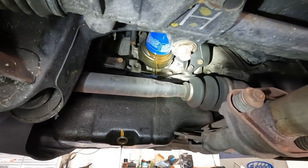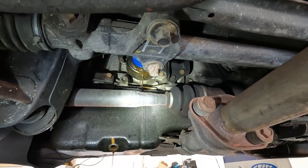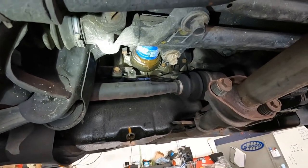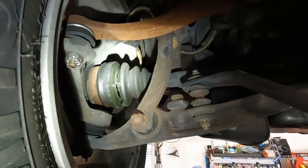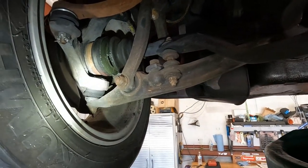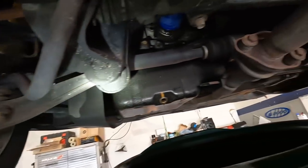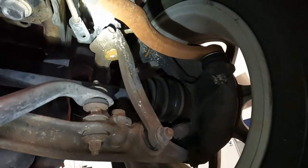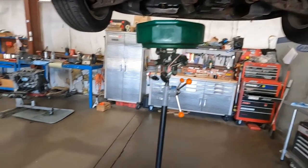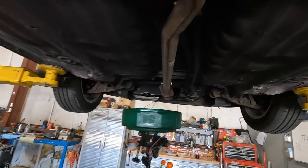Right now I'll just teach him basic maintenance, and of course if he's going to drive this a little bit he should practice it. I just want to make sure the motor is okay. My long-term plan — I think we're going to put another single cam in it, maybe a single cam VTEC, change the transmission. The HF transmission has a really tall gear ratio, and a Civic EX would be better with a CRX SI transmission. There's a boot split right there too, but it's got good bones — everything else is decent. Ball joints might have to be replaced, just some basic stuff. I think it's going to be good for him to get involved doing this because he'll have more respect for the car if you do it yourself. Plus, it's better getting oily hands than playing video games.